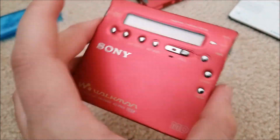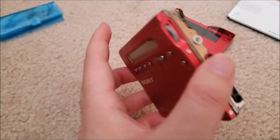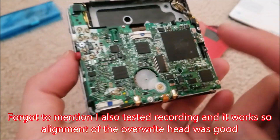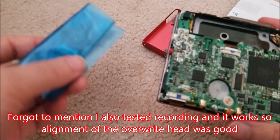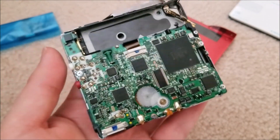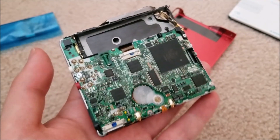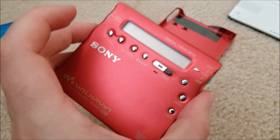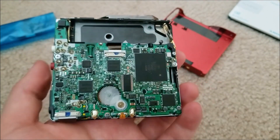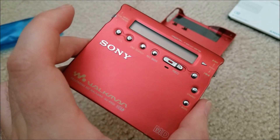Other than sticking the back on, you do have to be careful where the little fingers are for the switch locations, otherwise you can break them off. So this has been how to swap out the laser and reattach the overwrite head. If you have a minidisc recorder and you can get a spare laser — maybe from another minidisc player with a broken screen — you can actually swap out the lasers without too much trouble. Just remember to lubricate the rails really well, otherwise you'll have trouble playing after reassembly due to too much friction. I'm going to give this a couple hours of playback to make sure there are absolutely no problems. With a brand new laser, hopefully I'll get another few decades out of this. Hopefully you guys enjoyed this video — see you in the next one!